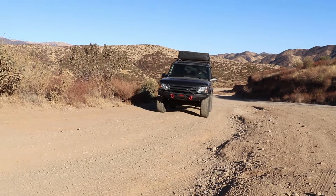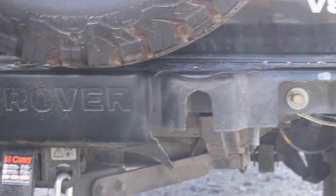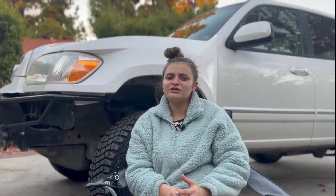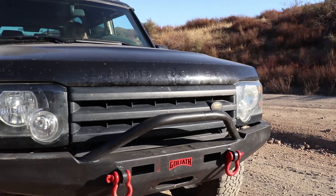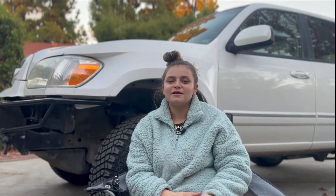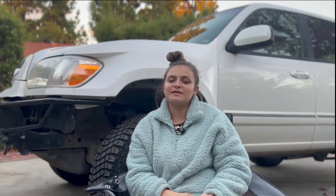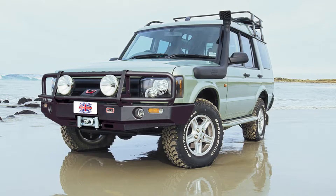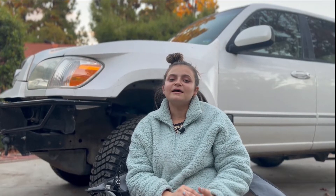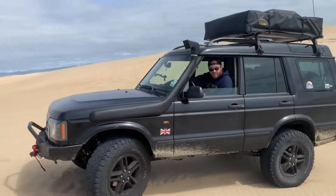The third modification is a front steel bumper. These cars come stock with plastic bumpers that break and get weathered over time, and it's actually really hard to find a Discovery without a crack in the bumper, so this modification will really change the look of the car. We love the Goliath off-road bumpers for how sleek they are — and we're not just saying that because we're featured on the website — but there are also a lot of other options. On this D2 we have the Atlantic British bumper, which is not sponsored, and we were actually able to pick this one up secondhand. There is also the massive ARB bumper for our richer viewers, but in our opinion they're just too bulky. If you're thinking of adding a winch to the bumper then we would recommend upgrading the front springs as well. Replacing the front bumper is pretty easy but you will definitely need a friend to help you align it since the steel replacements are pretty heavy.